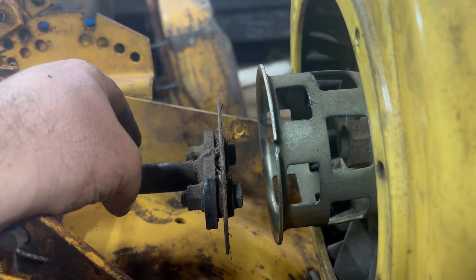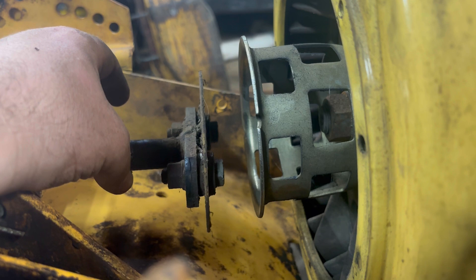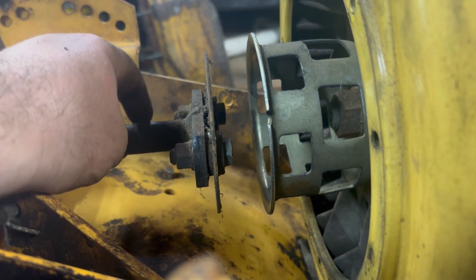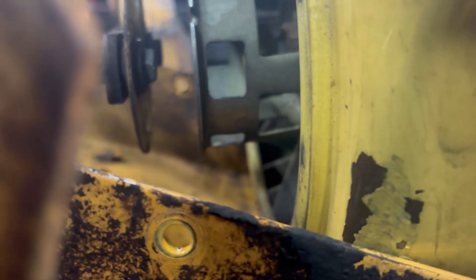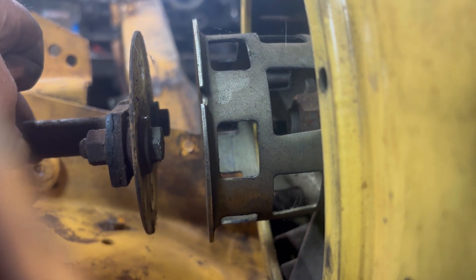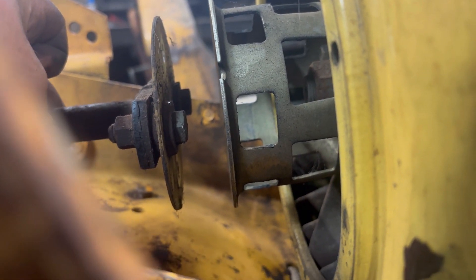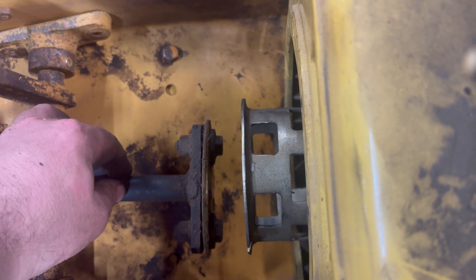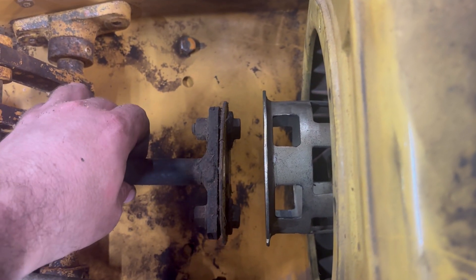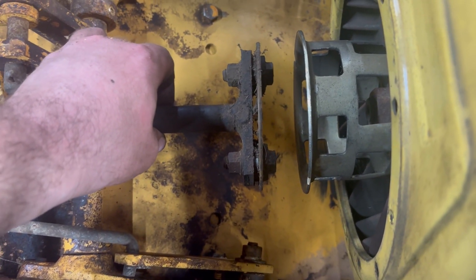Okay, I got the original drive shaft back in and loosely assembled. Now that I've got the plate cut down for this motor, it's made a big difference. This is free-hanging — it's got the weight of the shaft hanging off of it. I'm going to pick it up to where I feel like it's neutrally — neutrally buoyant, for lack of a better term — and try to sneak it in. That seems pretty close, and of course I'm going to use the bolt holes to center it. That seems pretty decent. I can go past where it needs to be, so let's go up and over to about where I think it's going to land. And we are clearing everything — that is going to save me so much time.